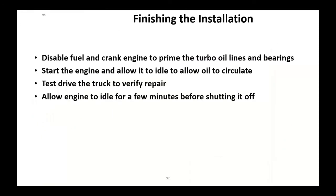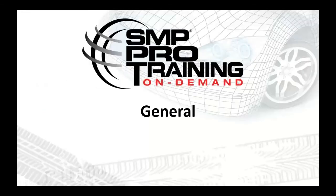Once the installation is finished, disable fuel and crank the engine to prime the turbo lines and bearings. Start the engine, allow it to idle, let the oil build up, and then go take it for a road test. Make sure when you come back, you check for codes, make sure there are none. Allow the engine to idle for a few minutes before you shut it off. Let that turbo cool down.